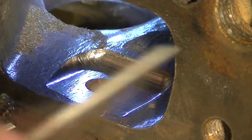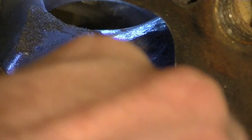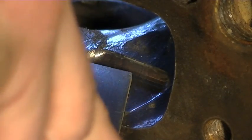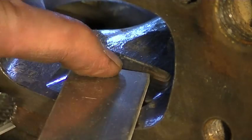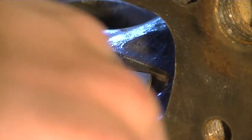Let's just test it. This is a 1/8 inch piece of aluminum, just to get a reference. So that's definitely deeper than 125 thousandths — probably 188 thousandths.